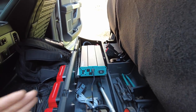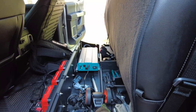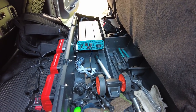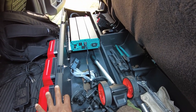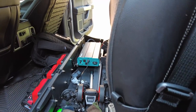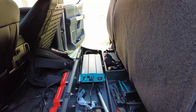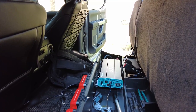Now for the mistakes made — number one, I should never have gotten a 3000 watt inverter. It's toward the upper end for a pure sine wave inverter, and the 4/0 wire is enough but the inverter wants you to be really close to the battery source, which isn't quite an option. Down the road I could upgrade with a battery bank — maybe two RV batteries in the bed of the truck with a shorter run to the inverter — then a 3000 watt inverter wouldn't be a bad idea.